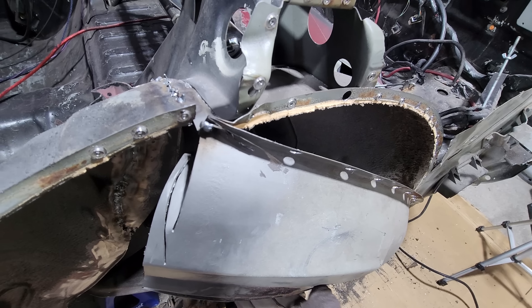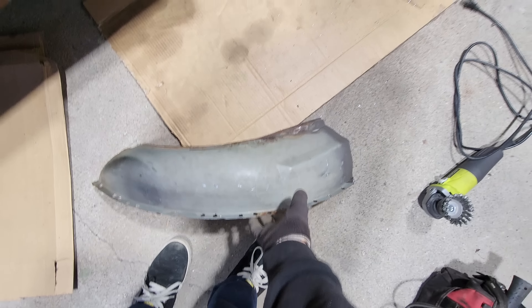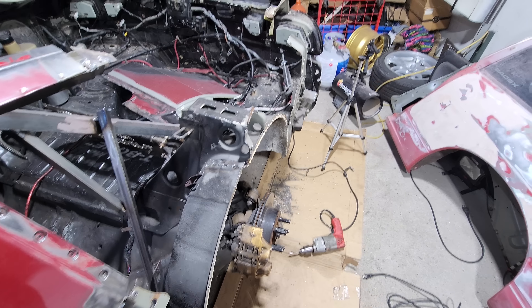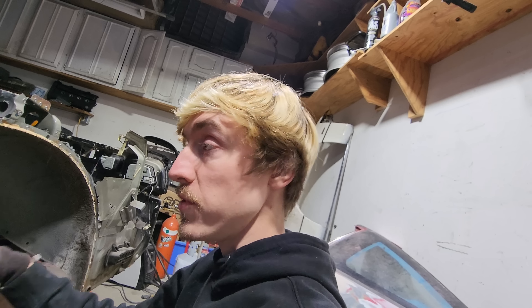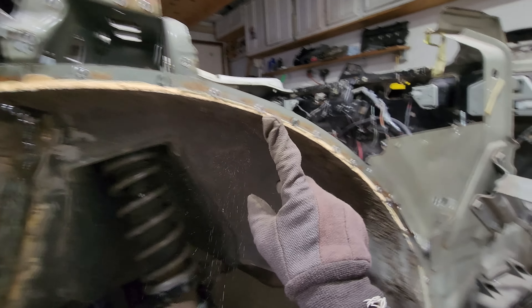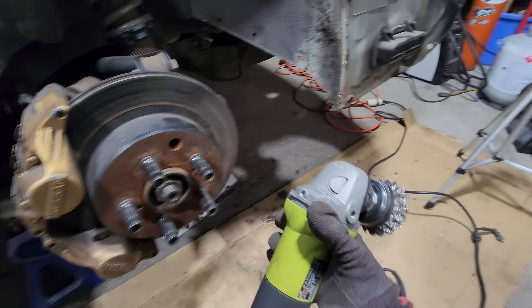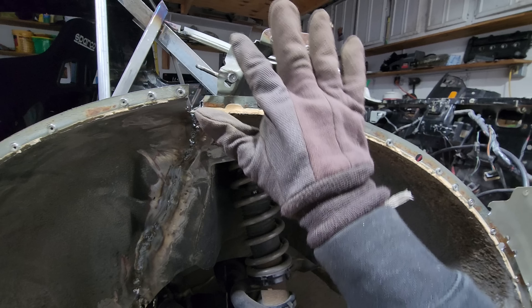There's one more right here, but unfortunately I have a little weld bead on there. Now there's really nothing back here. At this point, every piece of the quarter panel has been removed that I need to remove. Since I don't have anything to put back on it right now, I can still work ahead and remove all of this adhesive on here because this is going to have to come off regardless. I'm going to have to put new adhesive on once it's all welded back together, so we'll grab the wire wheel and get working on cleaning this up. I might as well prep all of these surfaces to be welded while I'm at it.